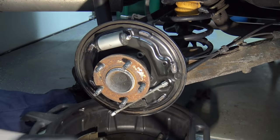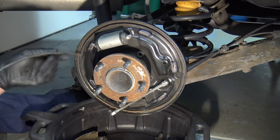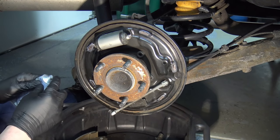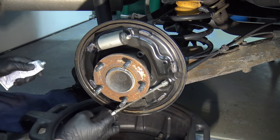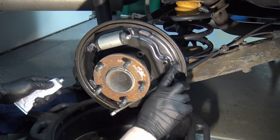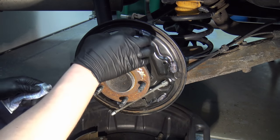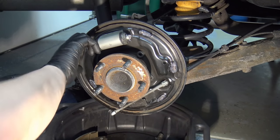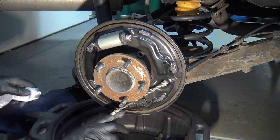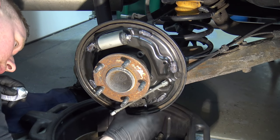You can use some compressed air in here, then use dielectric grease or brake caliper grease on each one of the contact points on the backing plate. This provides high-temperature protection and lubrication so it doesn't squeak. Apply it pretty generously — nothing too crazy. Because it's metal-to-metal up at the wheel cylinder, give a little bit to that groove there, and the same thing down at the anchor point where that shoe will be sitting — just so it's not dry metal-to-metal vibrating and squeaking.